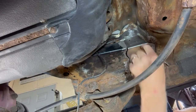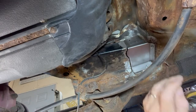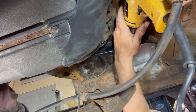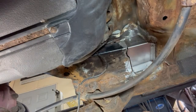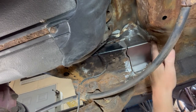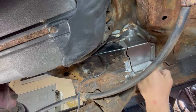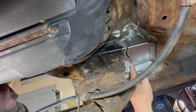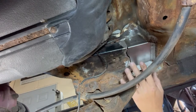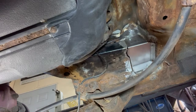Got the patch panel in place with a couple screws — the last screw goes on top, just used a pilot hole, using self-tapping screws. Everything's in place and looks good. Before I take this out, I'm also going to put new lines around here. I did clean this up well, but I want to make sure where I'm going to weld is really clean — I'll weld all along this flange, the bottom edge, and all the way across the top and down. This thing is going to be rock solid.